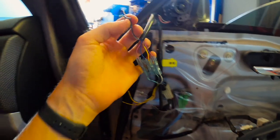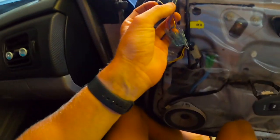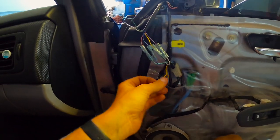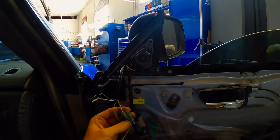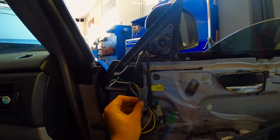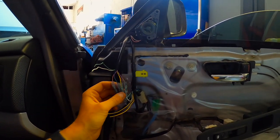We will be wiring the turn signal up through the headlight. Also, the JDM fenders have this little marker light on them — we will be wiring those as well. For now, we're just going to go ahead and get this back together. One other note: these two wires coming from the original harness are for the heated feature, and these mirrors do not have the heated feature, so we're just going to tuck these in. We'll go ahead and get the whole door panel back on and then take a couple shots of the car.